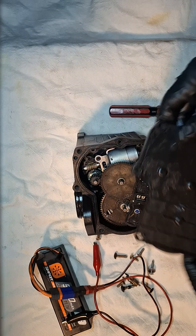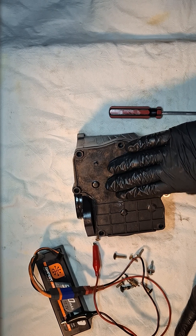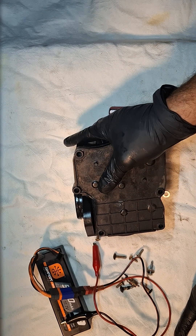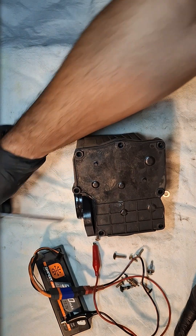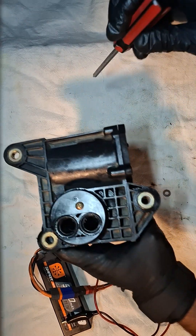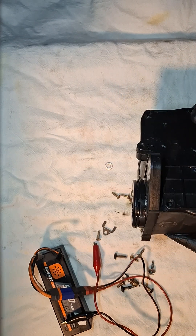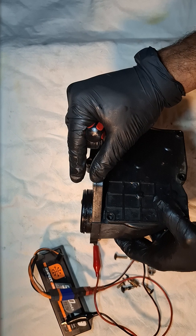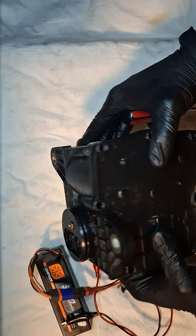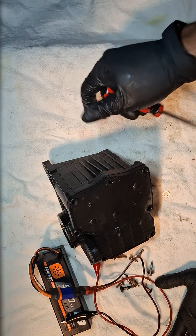Once it's done, you're going to come in and fit it again, close the lid, and do your screws. Worth mentioning: if you are going to remove this, make sure your car is not in gear and not engaged in four-wheel drive. When you put it back, make sure both shafts are in position — not out, but in position. Once you push it in, you should hear a clicking sound from the gearing engaging. The best method is to push it in gently — there will be a small gap — then apply the bolts and the bolts will push it fully in, and you will hear the clicking of the engagement.